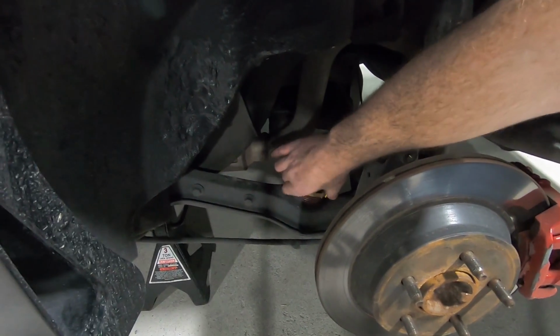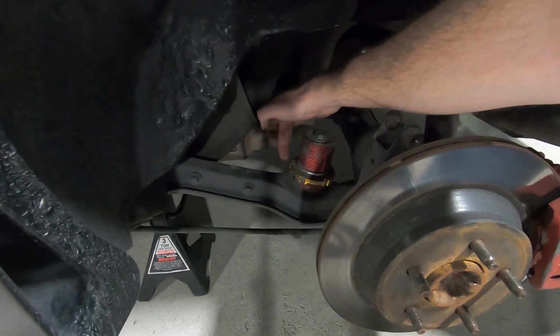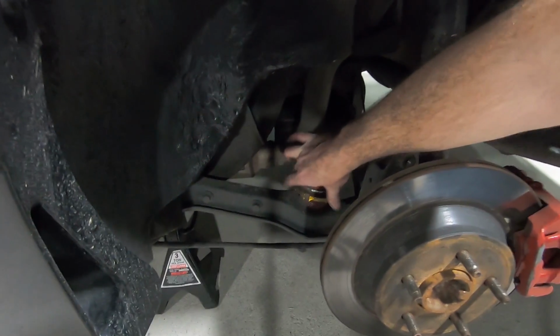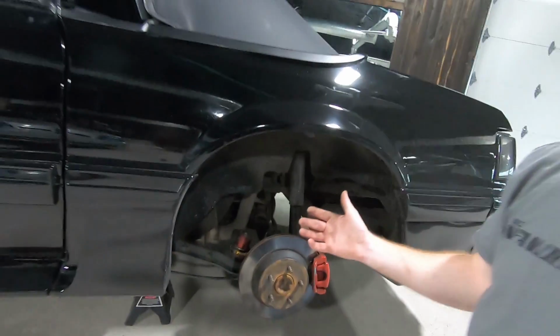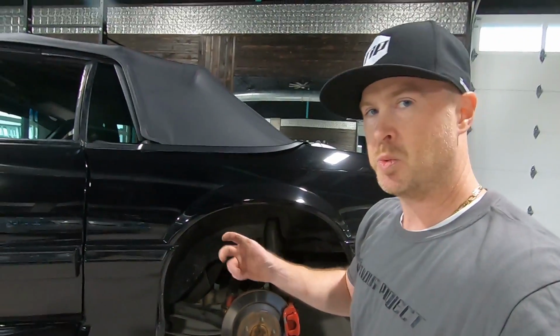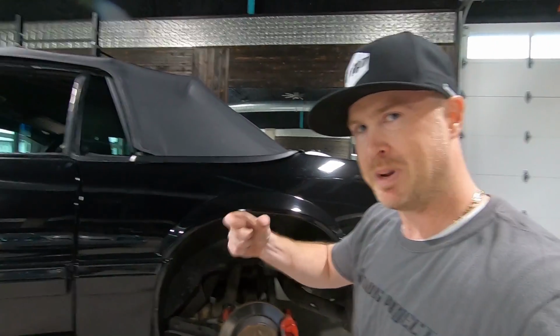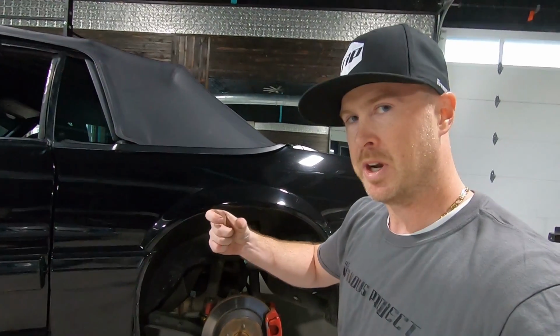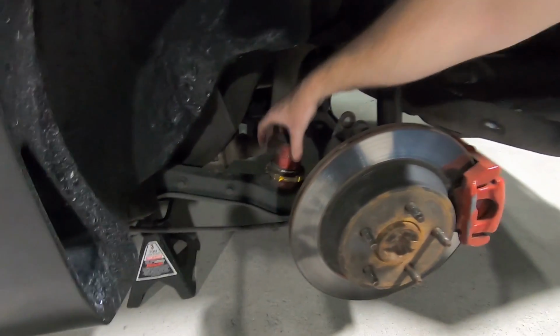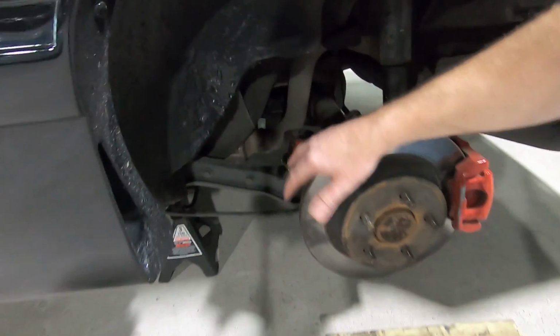Then it has the adjustable ring that actually has a little Allen screw that tightens it to keep it in place. Some of these use two rings so that it does the double locking. This one just has the one, and when you tighten that screw, it just pinches the ring to the threads of the perch. So this is my rear suspension setup.